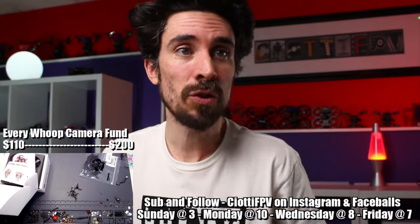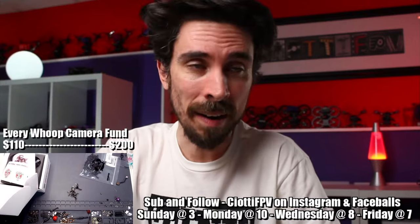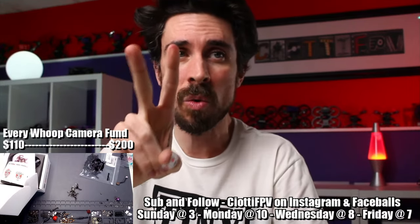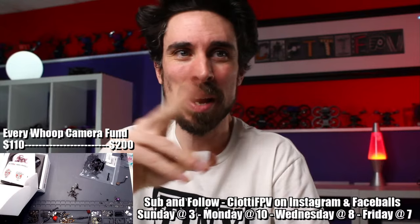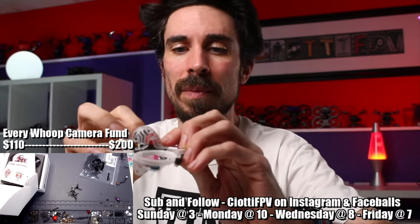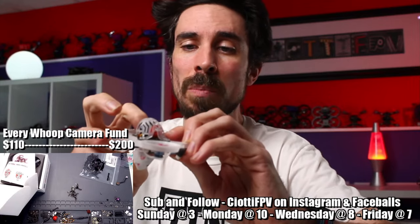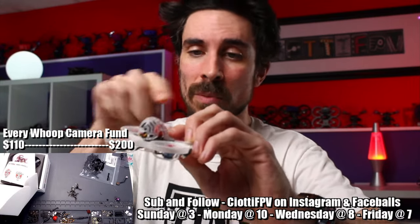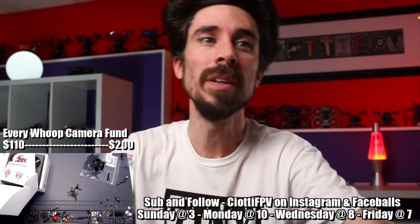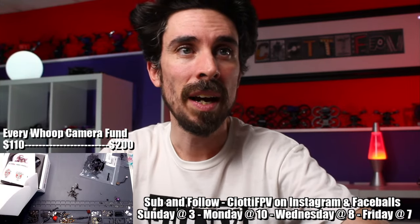Freshbread says, would you rather have ceramic antenna on that or the wire? The ceramic antennas are heavier than the wires and they typically don't work as well. So yeah, on the old Mobula 6 AIOs, when the ceramic antenna would break off, I would be happy because I'd replace it with a little piece of wire and it would get better reception and it would be lighter and more durable. So yeah, I don't like the ceramic antennas.